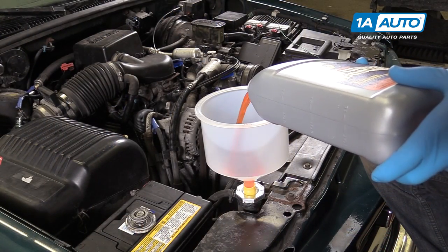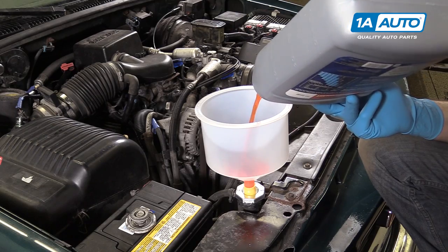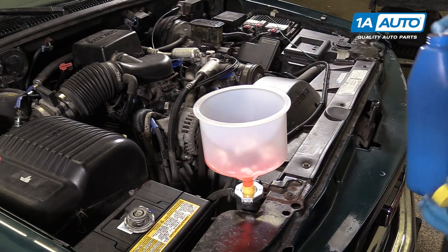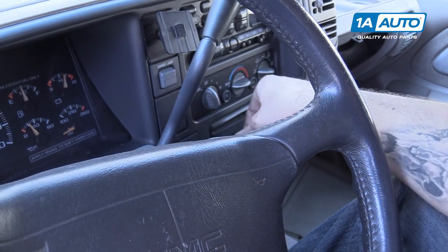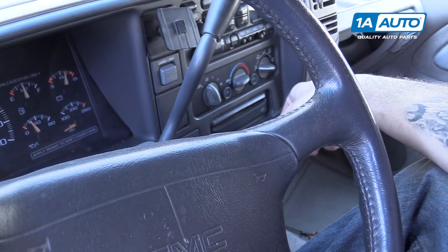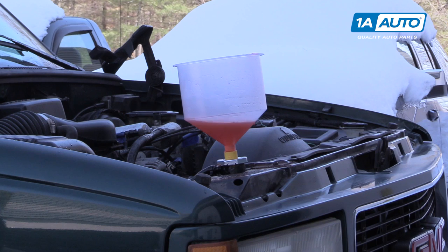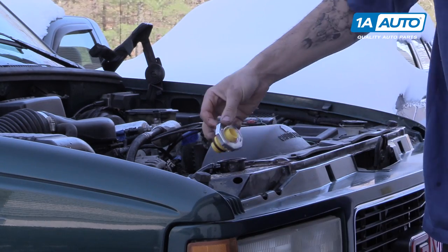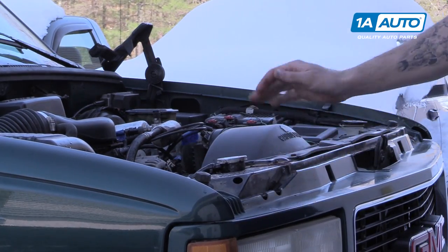Fill your vehicle with a 50-50 mix of DexCool coolant. We're using a special funnel to show how much air comes out of the system, but any funnel will do at home. To finish bleeding your cooling system, simply leave the radiator cap off, start your vehicle, and set your defrosters or vents to the lowest fan speed and highest temperature setting — this will allow the heater core to bleed as well. Run the vehicle, keep an eye on the temperature gauge, and monitor the coolant level inside your radiator, topping off as necessary. There will be several surges where it burps and an air bubble comes out, losing some fluid — top it off and this process will probably repeat a few times. Remove your funnel, reinstall your radiator cap, fill the overflow, and your vehicle is good to go.